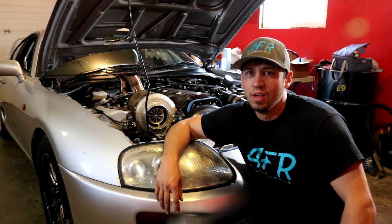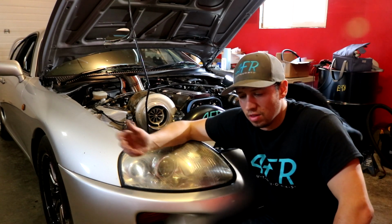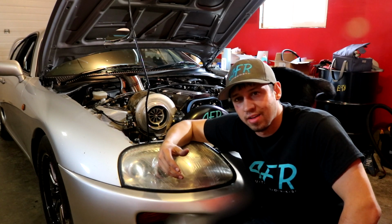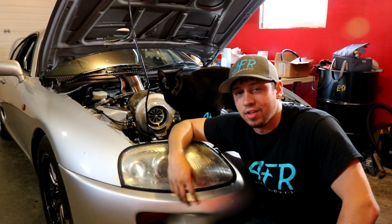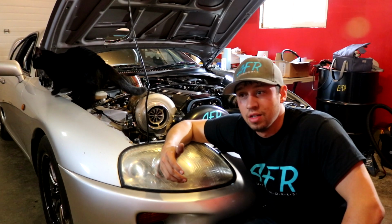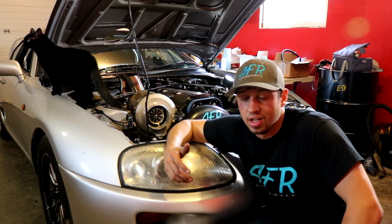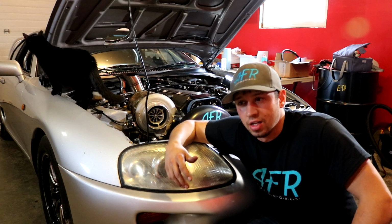Alright, so as you guys can see in that last video, we did have the misfortune of the transmission sticking in third gear. I have no idea what it is, but I've contacted a couple guys and asked them what their opinions are. It could be that I rolled one of my sprags, or something could be sticking in the linkage. Nothing felt like it broke. It just kind of stuck in third. So I'm hoping it's nothing major, and we're going to try the basic things.